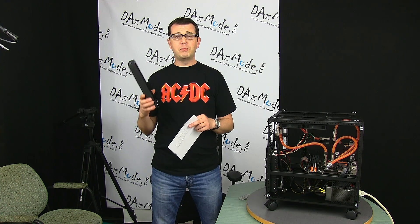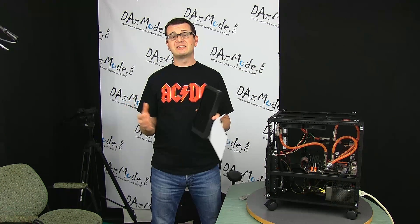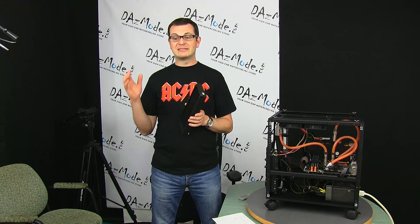When I put the GPU under stress as well, the system started heating quite a bit more. The difference increased to a whopping eight degrees — almost nine, specifically 8.75 — so almost nine degrees difference between dirty and clean radiator, which was much more than I expected. I honestly didn't think it would be more than five degrees, but almost nine actually makes a strong case against running your computer dirty. If you want better performance, sometimes you need to vacuum it out.